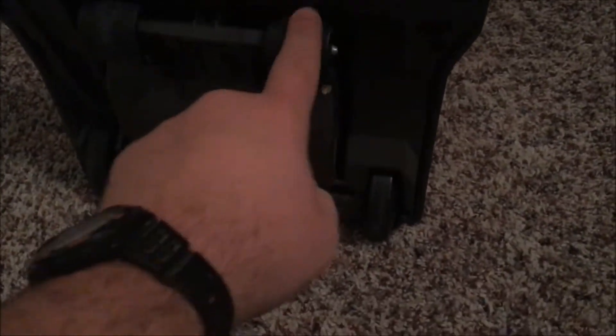To do this you're going to have to take the bottom plate off. To do that you are going to have to pry these latches down here on the base of the vacuum — which is really easier said than done. Just pry this down; don't worry about breaking it, although I do try to be delicate because this is an all-plastic machine. Just like that, your whole bottom comes off.